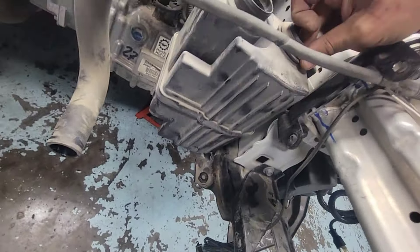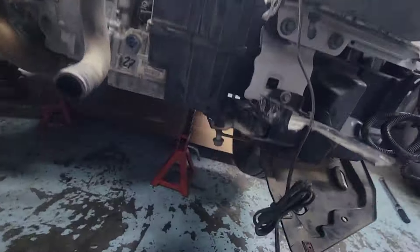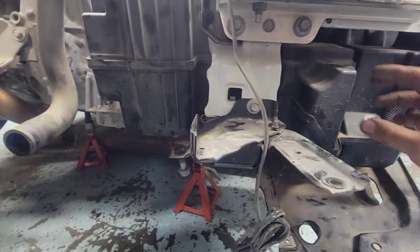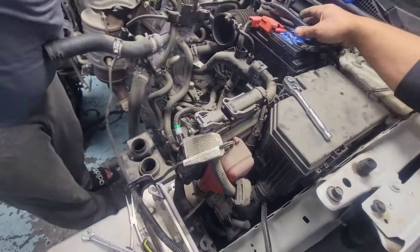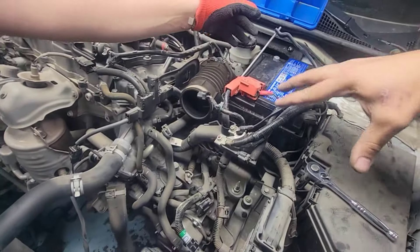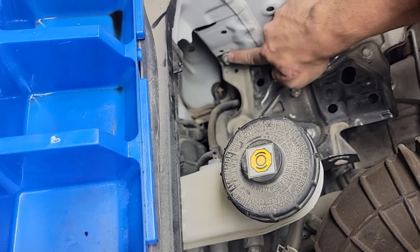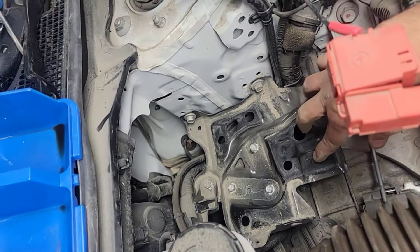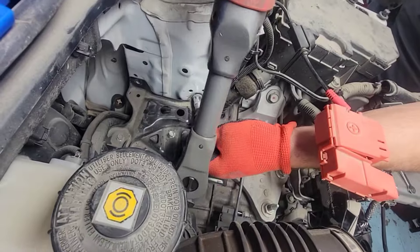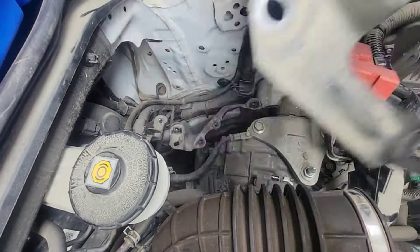The bolts are out, but this piece is all one unit — it doesn't split in half. I'm going to leave it for now, because to take it out you'd have to remove this lower frame so the piece can drop underneath. We'll deal with that later. Next, the battery: take out the brackets and bolts, the positive cable, pull out the bracket, then the tray underneath. Battery's out — now take out the tray. There are three main bolts plus one more: 12mm on the three, 10mm on the middle one.